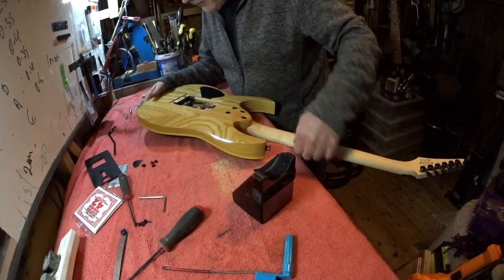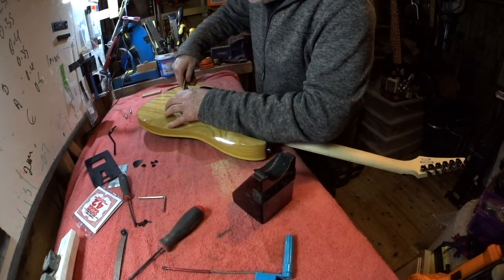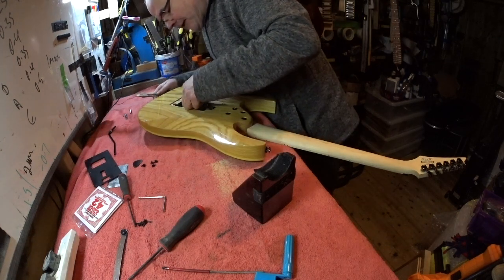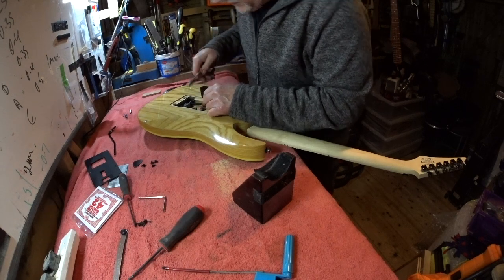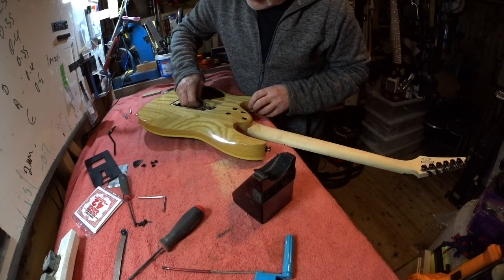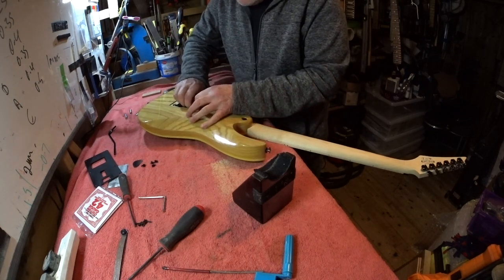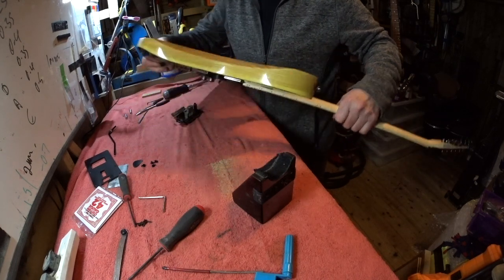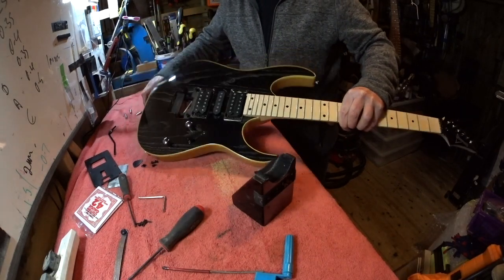we could take the other ones off, which come off here. This is without changing any of the adjusters. The spring comes off here. It's actually quite relatively easy to remove like that. This one off there. So that's taken all the loading off and the whole thing comes out like that. So we know where we've got to put them back together again.